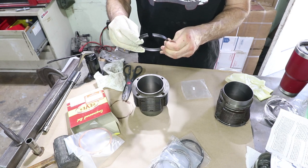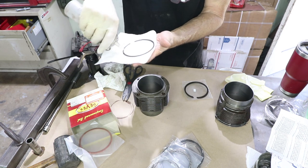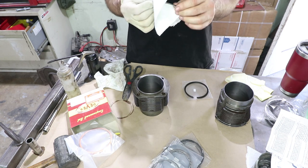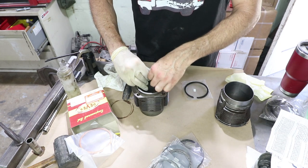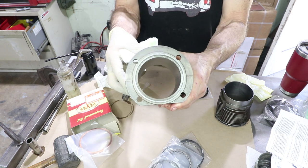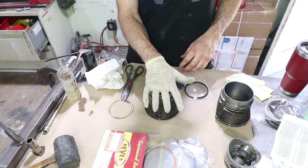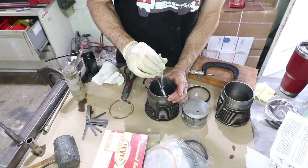They're stuck. This is what I use to clean my paint gun. This has like a protective grease on there and it's really thick and kind of dried out. Much tighter gap, which is great. I think it's 13 thousandths — that's definitely towards the higher end. I'm going to measure the internal diameter because maybe these cylinders have been bored too big. This isn't a digital micrometer but it is a US Mitutoyo. I measure 3.3847.